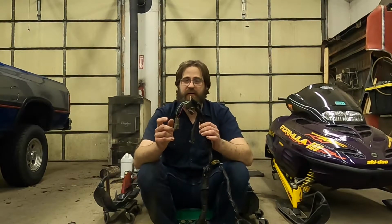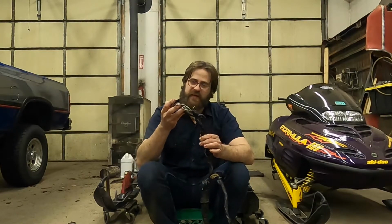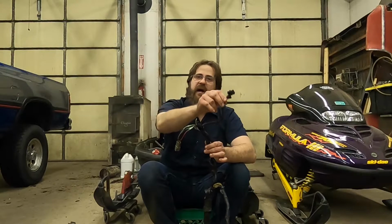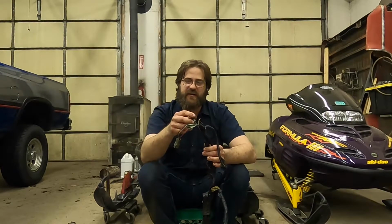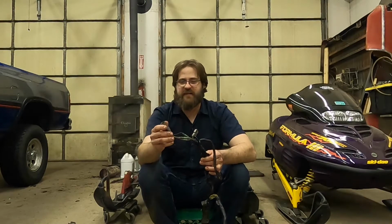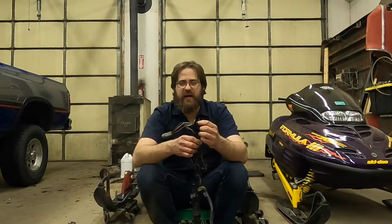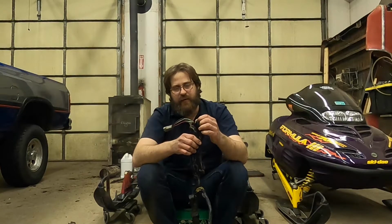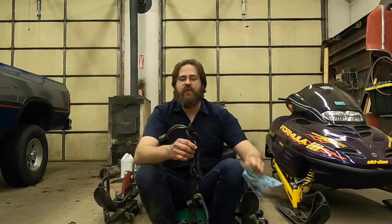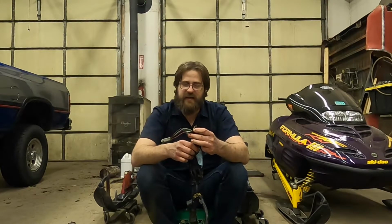I think, yeah, it's right in front of my face, so this is definitely in view. So this end sits, these connectors all sit right above the recoil side. So if you've got one of these, this is our temperature sensor. Here's our crank trigger or pickup coil connector, and then this is the stator connector. You may be able to see there are two wires that are cut here. So this is a blue with yellow and a white with yellow tracer. Those are the wires that went to the secondary or reverse pickup coil on this engine.